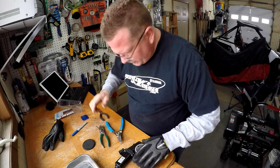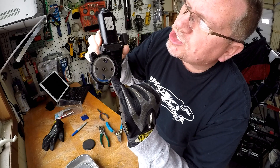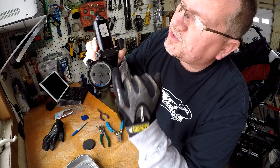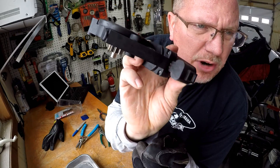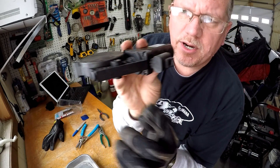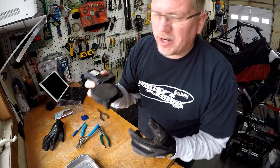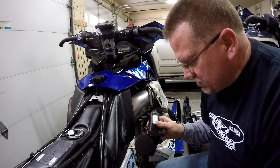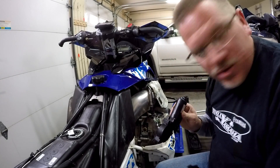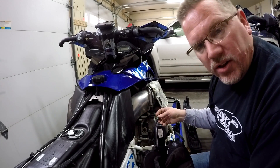We took those gears and moved them off to the bottom, so now when it rotates it should be using fresh gears. In actuality it goes from the top over and back again, so we shouldn't be touching those worn gears anymore. We'll put this back together and get it back on the machine. Be really careful putting this back on - as you can see they tightened it way too much at the Arctic Cat factory and cracked the housing, which isn't cool. But it'll still hold and go on just fine. We'll connect the wiring harness back up.